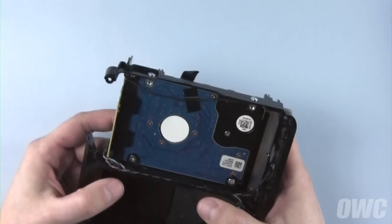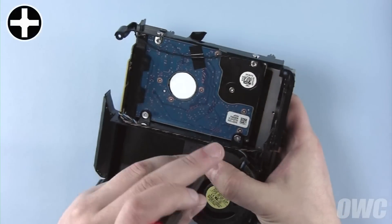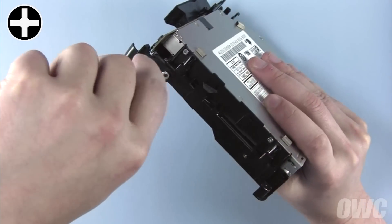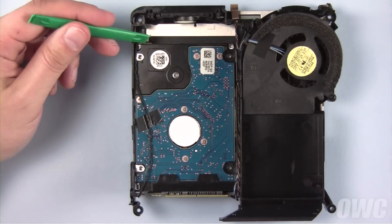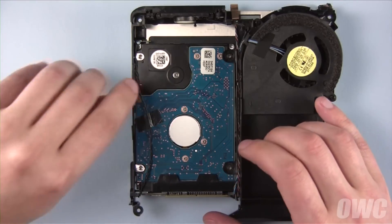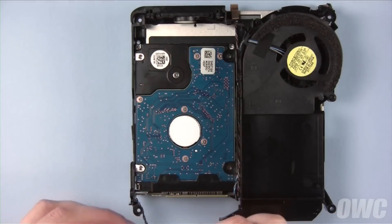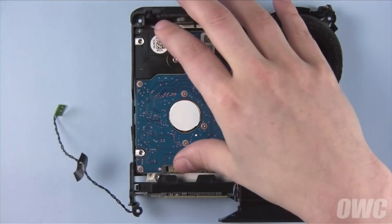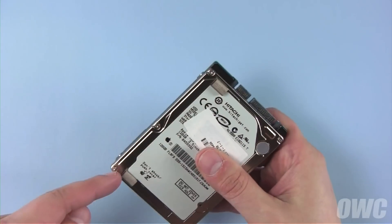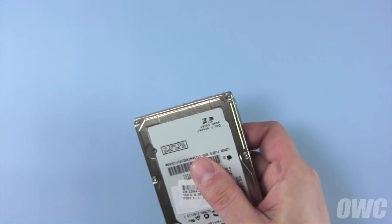The hard drive is located on the underside of this assembly. It's held into place by these four screws, which will need to be removed. Next, you'll need to remove the temperature sensor. Use your nylon pry tool to gently pry the sensor loose from the drive. Then detach the tape holding the cable to the drive bottom. Push the drive forward within its bay to loosen it from the SATA connector. Then, use your pry tool to help lift it up and out of the assembly. There are two anti-static cushions on the drive which will need to be removed. Gently peel them off and set them aside.